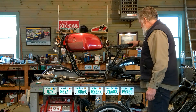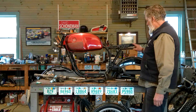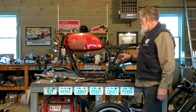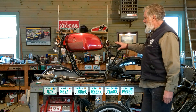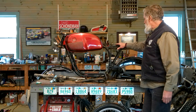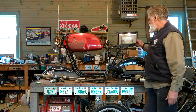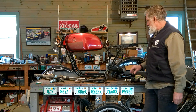The rear part of the frame — this section all the way back here and down here — is separate; it's bolted on and can come off. I have probably four or five of these pieces, slightly different based on the swing arm and year of the bike. This one is marked as a '79, and it'll work with the '76. I'm thinking this bike is going to be for a one-up rider, not two-up, so we may use a shorter rear frame section. This one has good mounting points for the fender.